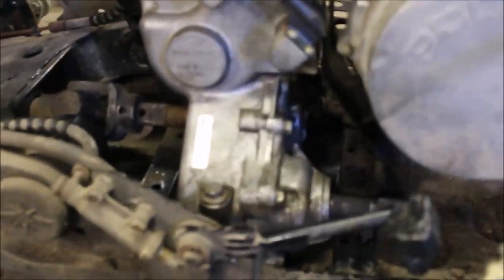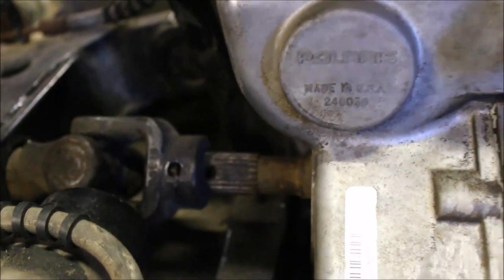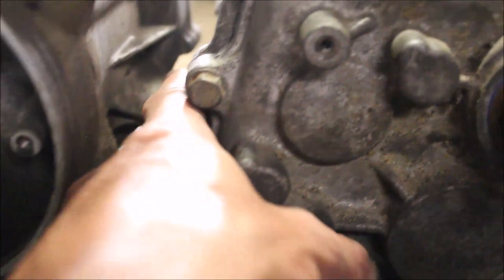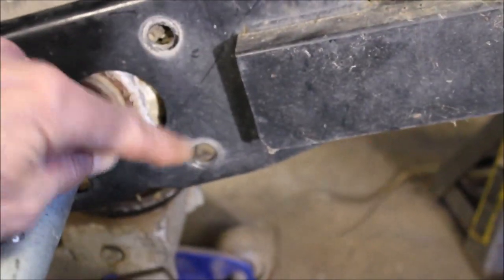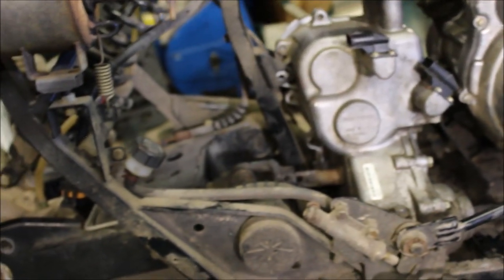The transmission is dropped into place — it sits in the grooves right here and right here. I'm trying to get that driveshaft slid onto the output shaft. I'll throw the bolts in: one goes down here, one here, two that go here, and then one and two that go here and here — that bolts everything into place. Then I'm going to shove the rear axle forward; there are three bolts there. Once I shove it forward I'll put those bolts in, hook the shock back up, and then I have four bolts that go right here. Once all that's bolted up I'll hook up my linkages and this should be good to go.